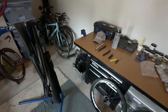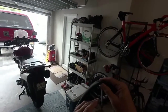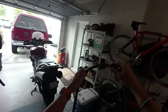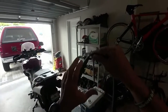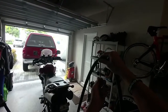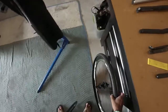Now it's time to put the new tube back in. I blow a tiny amount of air into it — either enough pressure so it holds, or I use gravity and keep the valve facing down the whole time. I want some air in the tube so it holds its form and is less easy to pinch as I put it back in the rim.